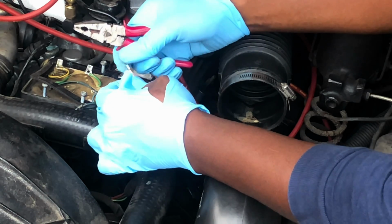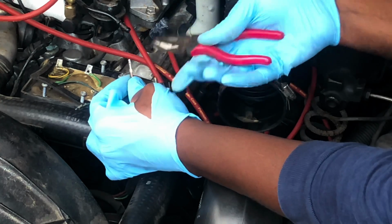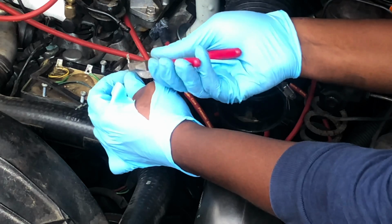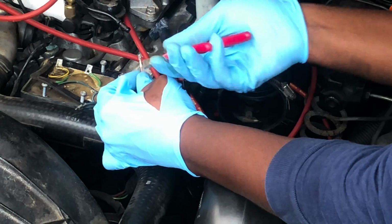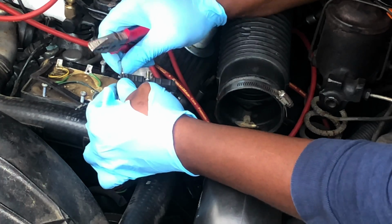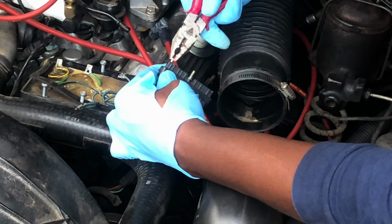All right, I'll inspect it, make sure everything looks good. I'll adjust it if it doesn't. You need to make sure the terminal is narrow enough to squeeze back into the hole. And then the bulb has to face the right way. So I'll line all that up, make my final adjustments. And then just push it in. Now the lock, you're gonna have to push down on the lock to make sure it doesn't snap. And then you can just wiggle things down and in there.